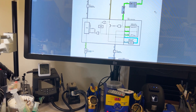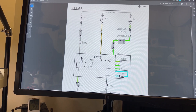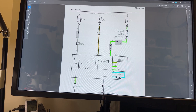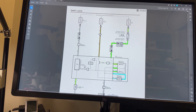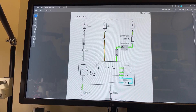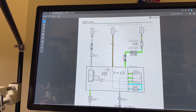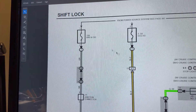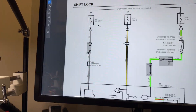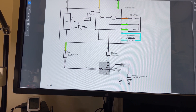The position in here is a little different, but we see that we have constant power coming through a fuse, through the brake switch, and then onto pin five of this module. Constant power again on number four, and then accessory power — that's what it says here: 15-amp fuse, radio and cigarette lighter. So that's accessory power, and then constant ground on pin one.